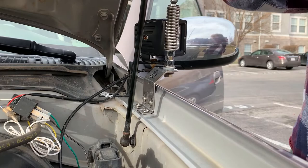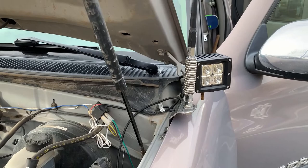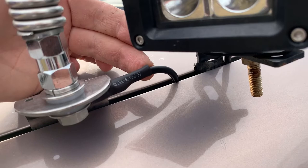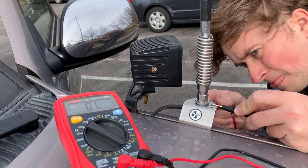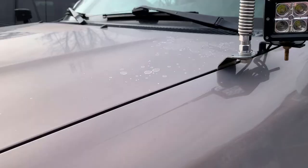Now make sure your hood closes right, and especially make sure it doesn't pinch the cable. I'm checking and I can see the cable can freely go in and out — it's not getting pinched, so no connection is getting severed. Once your antenna is essentially done and mounted, double-check continuity again. Make sure you're still grounded and that the black wire is grounding to the mount, but also check that your positive end isn't accidentally grounding — otherwise it'll be a short circuit and your radio won't work properly. And of course, remember to tune your radio after this.